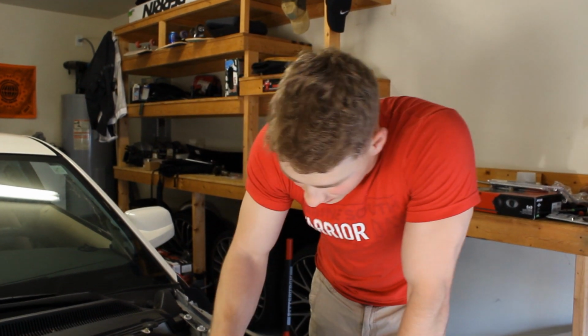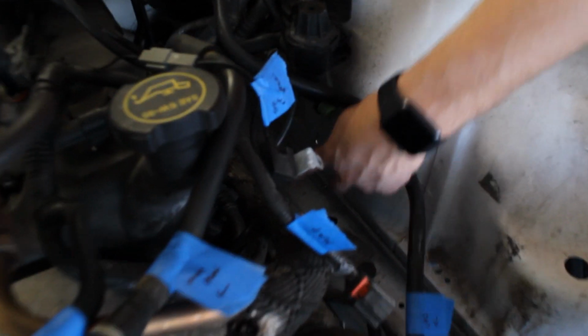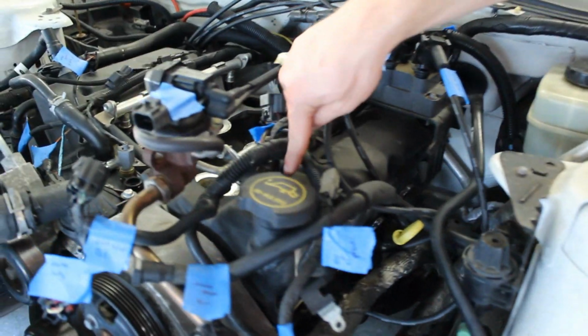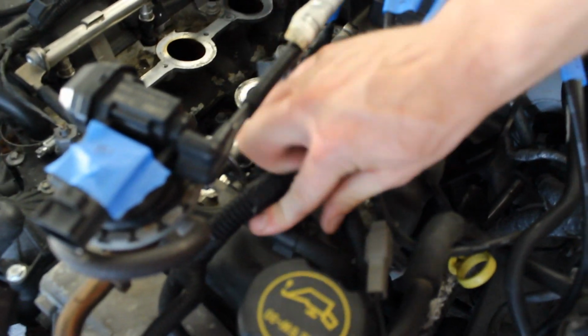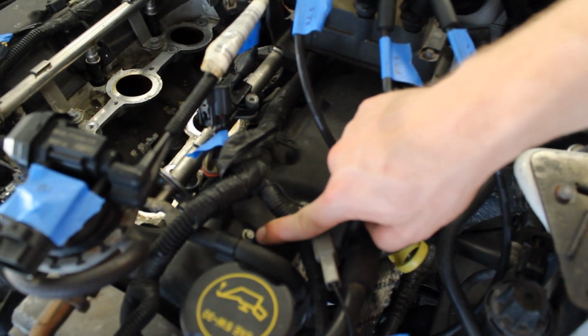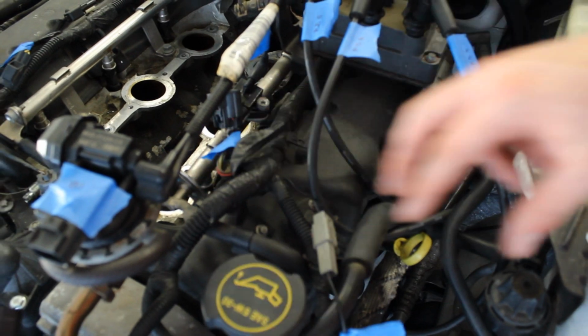Anyway, if you work your way down here, you've got where the fuel line connects to the actual gas tank in the back. You're going to disconnect that, and there's a mount or some joint right here. It's 1 bolt, and that'll remove it from the block. Following the line up here, we've got a small little thing. We might be able to just push it down, or we could just remove this 1 bolt here. It looks like it's a 6, and that'll allow all of that to be free.